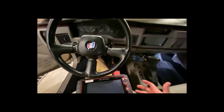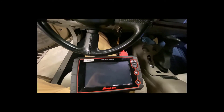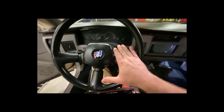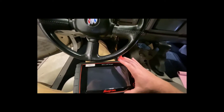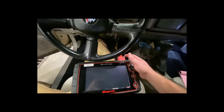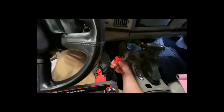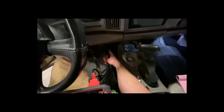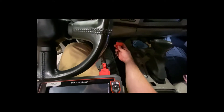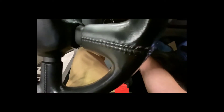We're out here in the shop in my personal car — my '96 Buick Roadmaster. We're going to use our Snap-on Solus Edge scan tool to verify operating temperature: what our car sees on the dash, what our computer sees and sends to the scan tool, and what the temperature actually is. We need to hook up the Solus Edge — the diagnostic cable is plugged into the scan tool, and the other end plugs into the diagnostic port in the driver footwell. When we plug the OBD cable in with good power, a green LED will illuminate and the scan tool will turn on.